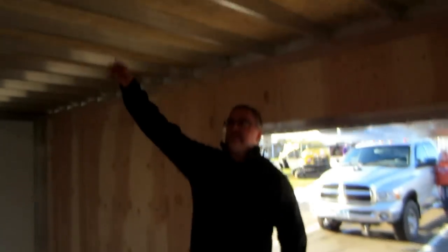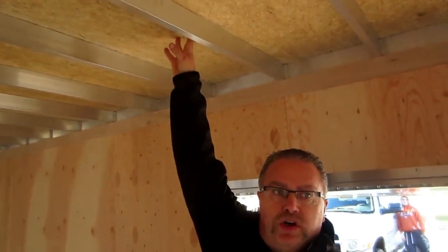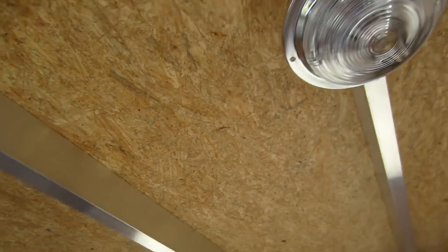To be able to do that, what we have for him is a walk-on roof. If you look at the inside of this trailer, first of all you see the thickness of these roof bows, and second of all there's three-quarter-inch material in between the roof material and the roof bows. So you can walk the full length of this roof on this trailer without having any problems at all.